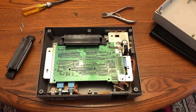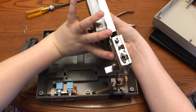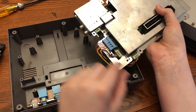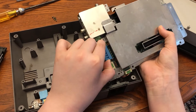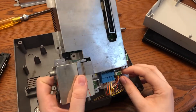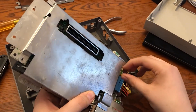As you saw, I had to use some pliers to get them out. Now, after you're done with this, you're going to want to take out all of these connectors. You actually want to be pulling by the wires, not the plastic. It's going to be hard because you probably don't want to rip them, but that's what you have to do.